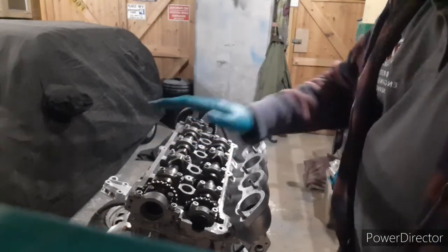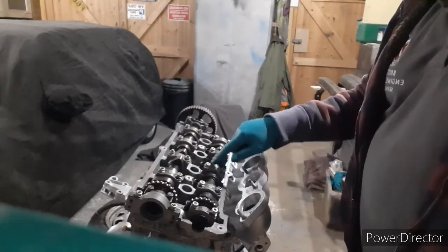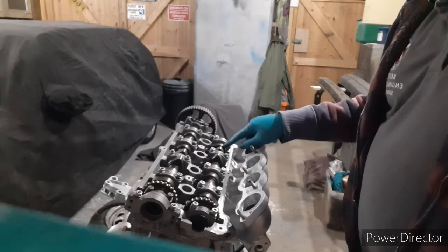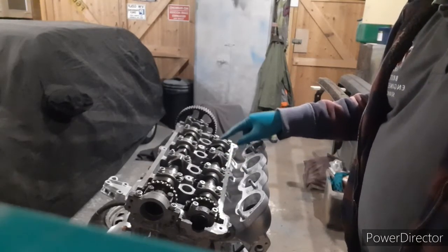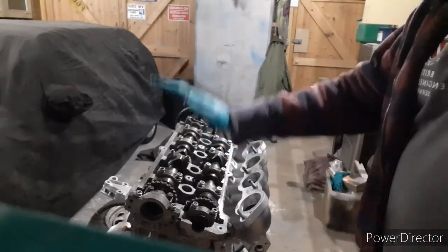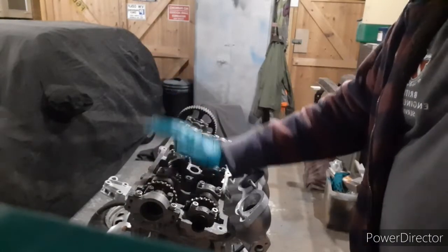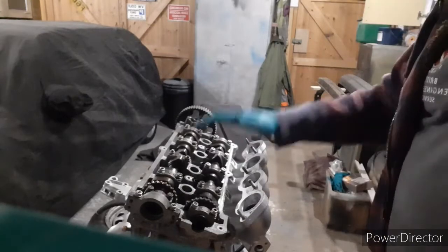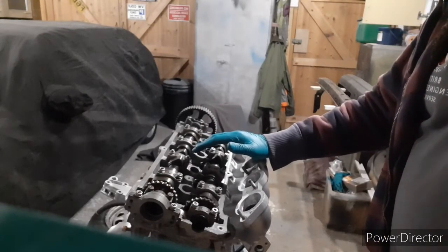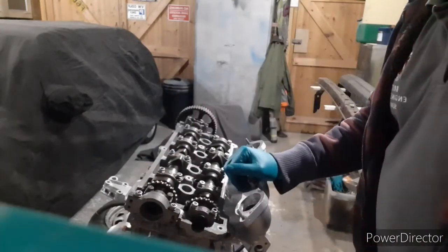It's aluminium, so you can't just torque those down randomly and then do others. Same with the camshaft — when you torque the camshafts down, if you tighten one end fully, then the next, then the next, it will probably snap the end of the camshaft. You want to nip nip nip — all nice and even. So: 40Nm followed by 60Nm, then 90 degrees, then another 90 degrees. It's easier to do two lots of 90 than trying to spin around 180 degrees, especially with the engine on the stand. So that's it — torqued.